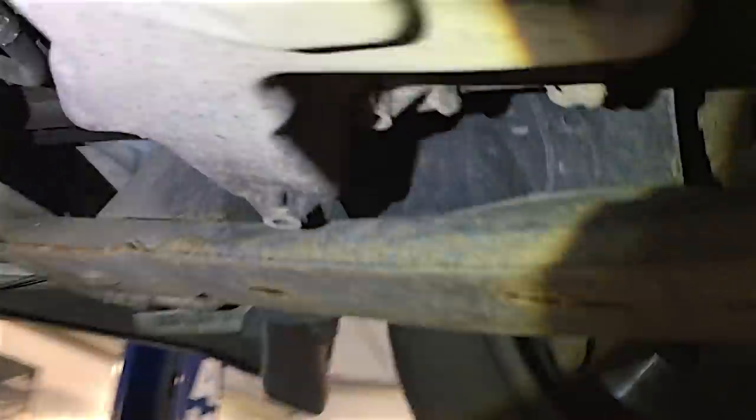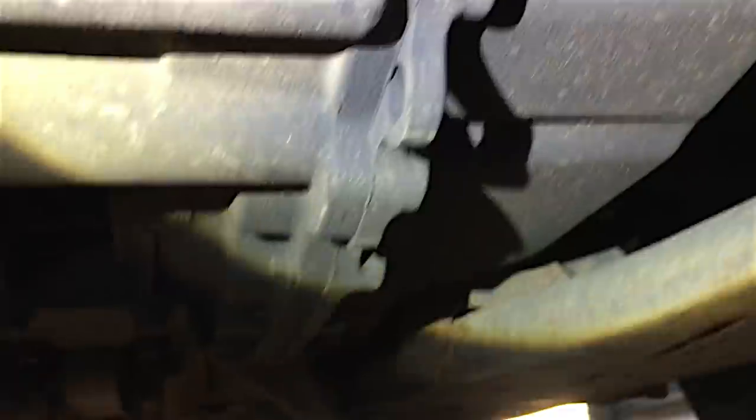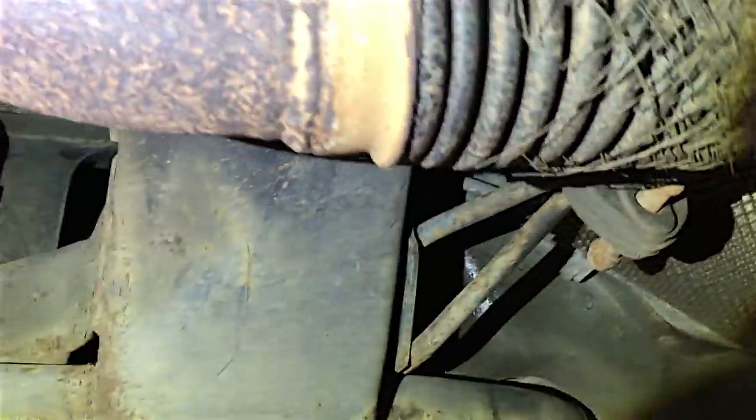I'm not actually seeing much wrong with this car, but there again there shouldn't be because it's just had an MOT - well, I've got to take it back for its retest. There's no oil leaks, it's pretty dry. This is an 05 plate. Up where the auxiliary belt is, keep an eye out for coolant because the water pumps do have a tendency to leak, and the automatic gearboxes can leak as well, but this one looks pretty good. Here is a problem part common to any car - the concertina flexible section on the exhaust; that can break and cause the exhaust to blow.